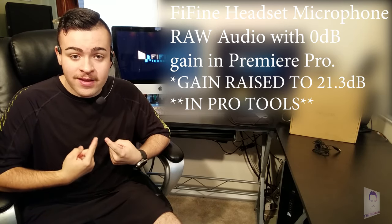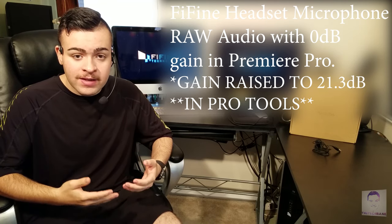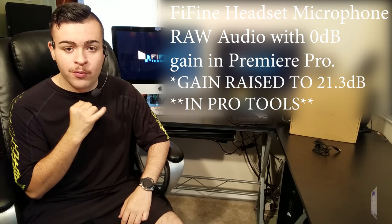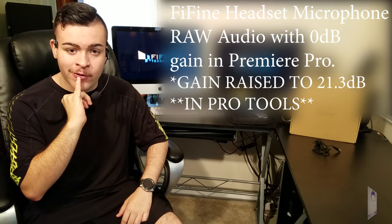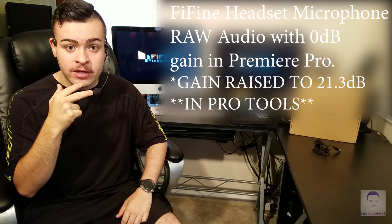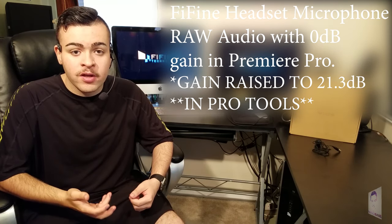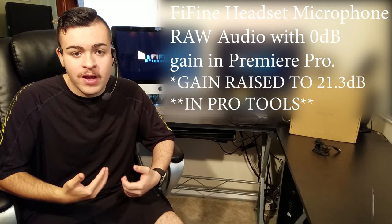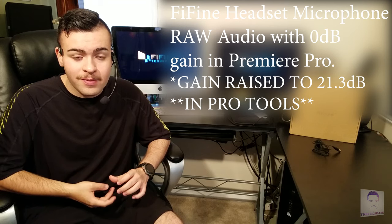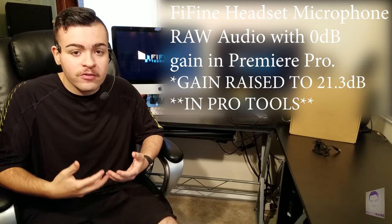Now, because of the headset being so close to your mouth, it's going to have much more of a dynamic range, and it's going to be louder because it's much closer to your face, unlike this one, which is just a few inches away from your mouth. Within this one, it's a few inches, not even. Now, I do like the sound of this in a way, but the problem is that, as you can hear, it's going to have a lot of plosives. So if I say berries, pencil, pens, pills, Pennsylvania, baseball, basketball, it's just a lot of plosives to it.